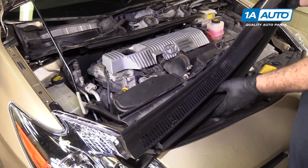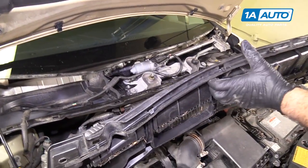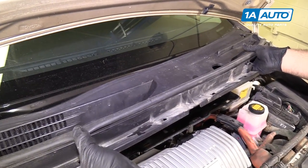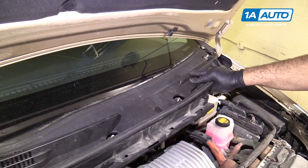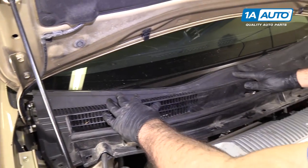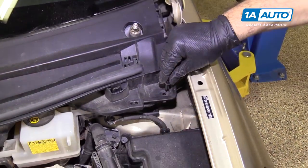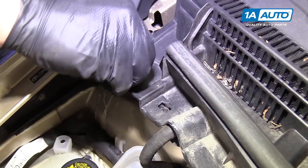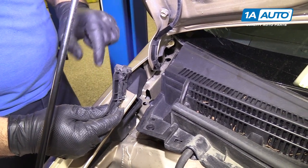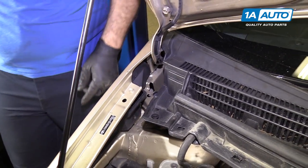The plastic upper cowl cover has some little tabs that slide underneath the windshield edge, and clips in the front that clip down into the metal. Get it in position over the wiper arms, slide it up, push it along the edge and slide it over the glass, then it will clip down into place. Replace your push clips — do that for both sides. Clip the corner pieces back in place: that part goes underneath the windshield, and these clip into the plastic. Slide them underneath and clip them in place — do the same for both sides.